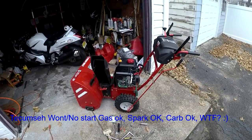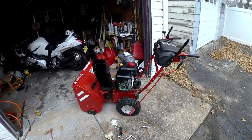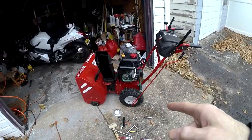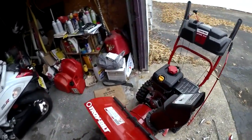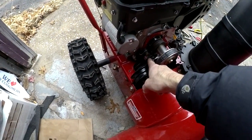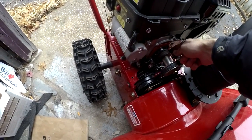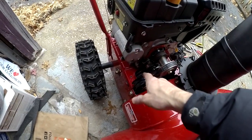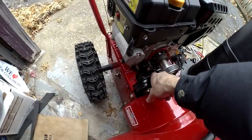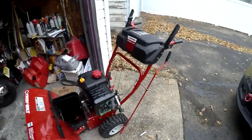Here's the procedural history: I bought this snow blower last year, started it, ran it, and at the time the pulley in the front — this pulley down here — had a loose bolt and the belt wasn't straight. It got chewed up and I had to pull it all apart, all the way down to the friction disc, to get the belt back on. Since then I've been making sure that pulley stays tight.